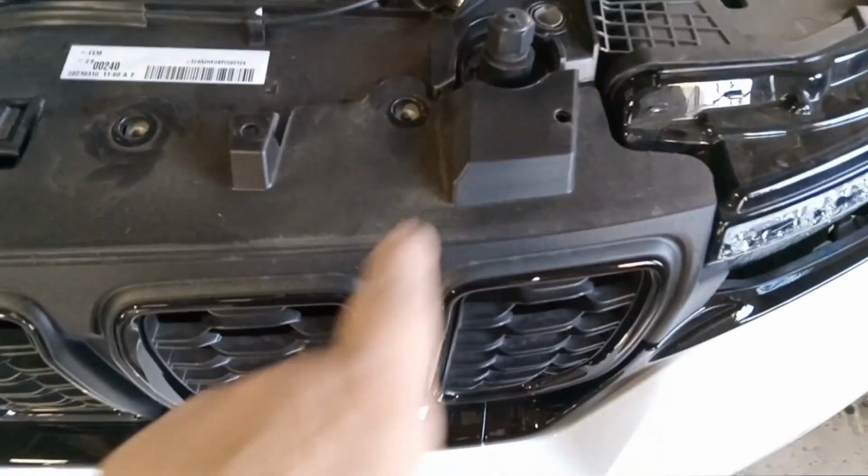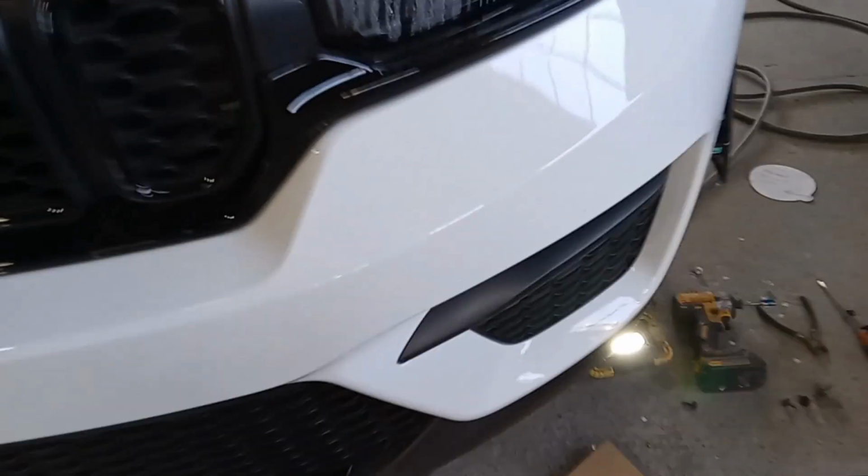So I took every bolt out up top here. They were Torx heads. And I went under here. I took the 8mm out there. Behind the spoiler is 3 clips. I'm going to try to swing that bumper out. It's crazy you've got to go through all this. There's the clips. To do this. Amazing.